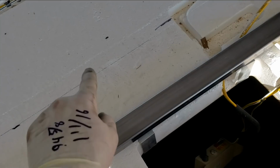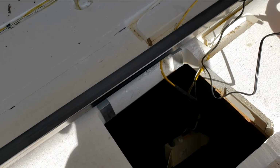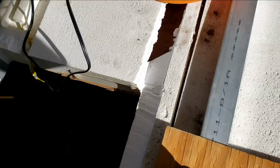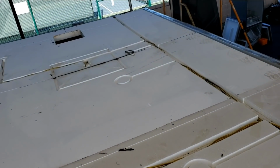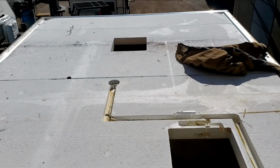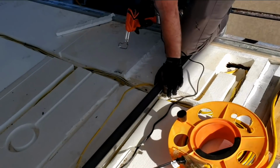We were going to go ahead and put one here and there, but the AC is heaviest in the back, and where 2 feet lands is right there. So it seems redundant to put one there and then another one 6 inches away, because this will be the middle of a panel. The middle of the panel is going to overlap that styrofoam seam. And you can see the next styrofoam seam will be there, so that'll be in the middle of the panel again too. Hopefully that keeps laying out that way as we go up there. We haven't decided if we need to add steel in the back, since that seemed fine because it has walls underneath supporting it. Waiting for Chad to make the decision on that.